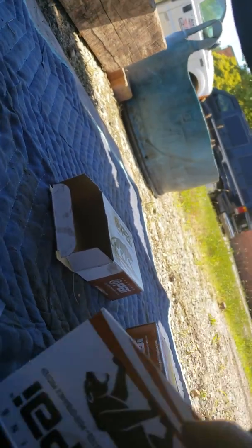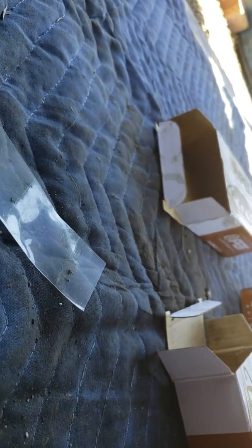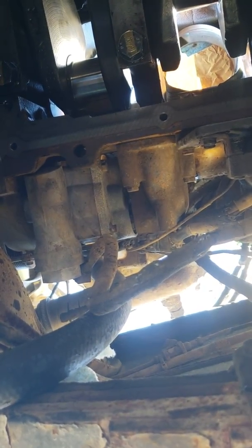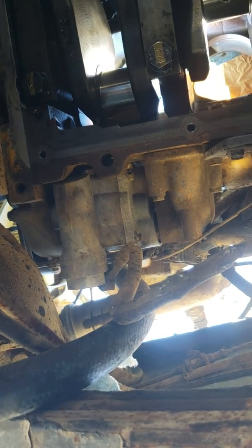Get a new bearing over here, show you how we're gonna put that in. Another thing is you can't really get the sizes mixed up because on this engine — and that's not the right one there, I had already put this one in on the wrong one — but it'll be okay. Ain't nobody gonna say anything, I don't think. Still gonna run good. Anyway, take that and let's make sure we got it all cleaned off, especially on the back. Make sure you don't have any debris in there.